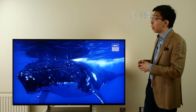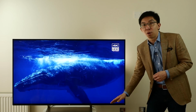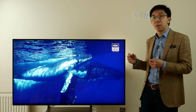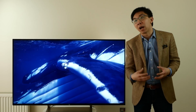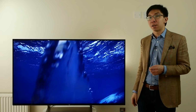But arranging the LEDs in this orientation is not without its own downsides. For one, the top and bottom letterbox bars in scope movies cannot be totally darkened. When bright objects appear against a dark background, the whole vertical column needs to be lit, so you not only get haloing or blooming artifacts, but also spillover brightening of the letterbox bars.